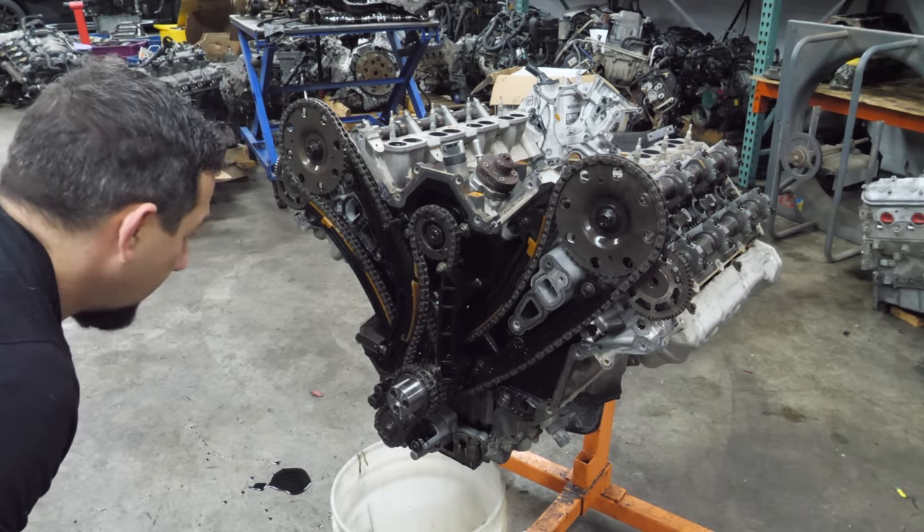This is the piston that made contact with the cylinder head — you can see the little imprints of the valves on the top. But otherwise all of the rods and pistons appear to be pretty decent, though they need a lot of cleanup. Now it's time to remove the crankshaft since it's in two pieces. I'm going to crack these bolts loose first before using the impact, since they're probably really tight.